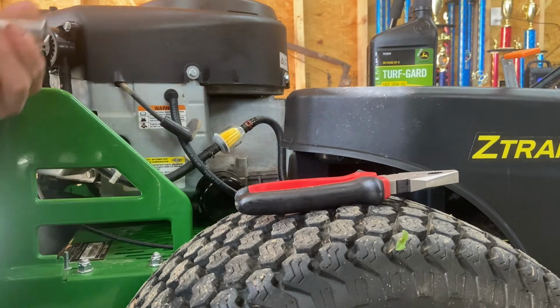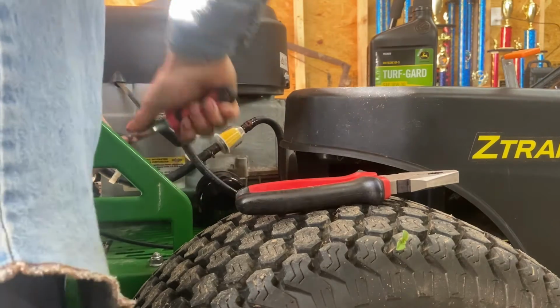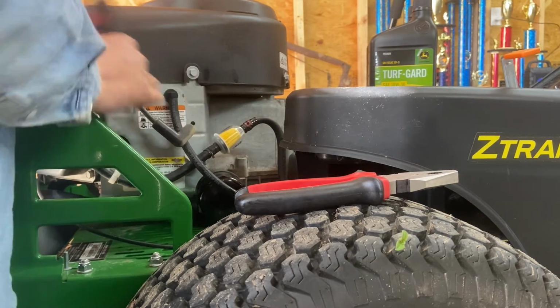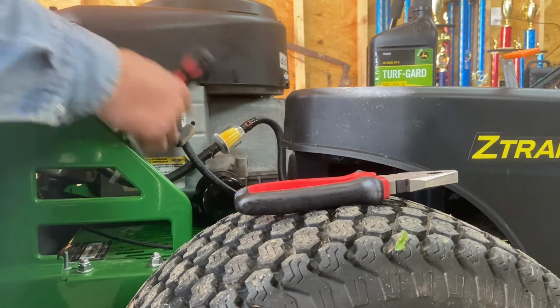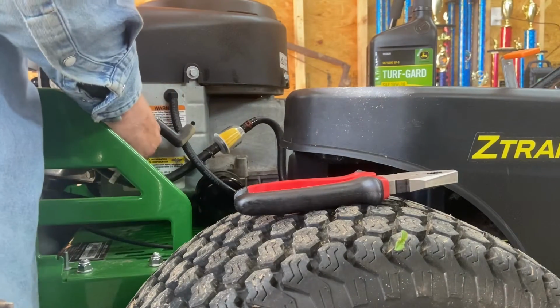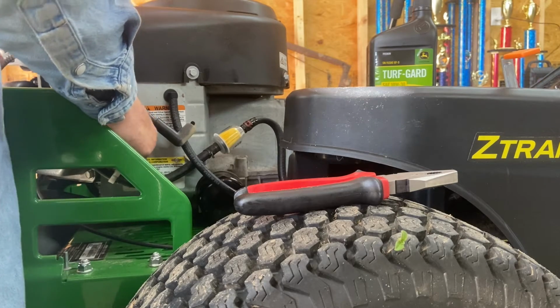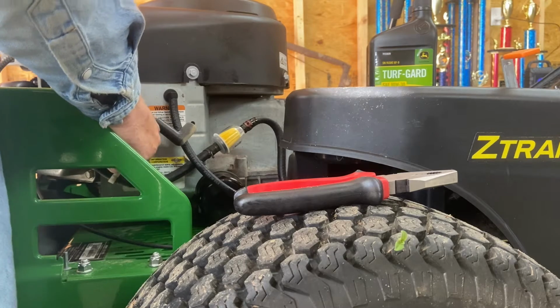Some people might not think it does, but it does. I've learned that the hard way on my blue truck here that you see in some of my videos. When I first built the engine in it, I was being careless, not gapping my spark plugs and stuff, and it makes a big difference. This is a 5/8 spark plug socket. I would get one of them. That's really about the only tool you need on this side of the video for just the engine maintenance.